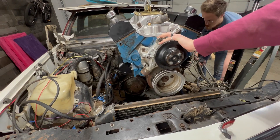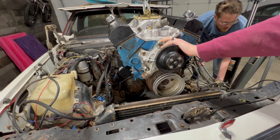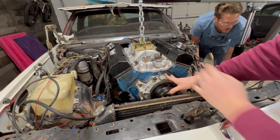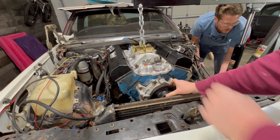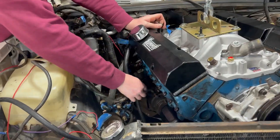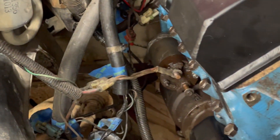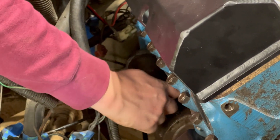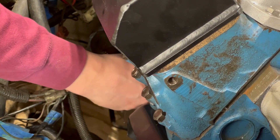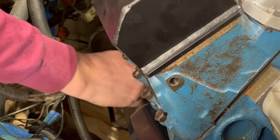Let's try going down with her. A great idea as you're dropping your engine is to connect your starter first. You just have better access before you get the engine bolted in place. You can totally hook up your starter later, it's just a little bit easier this way.